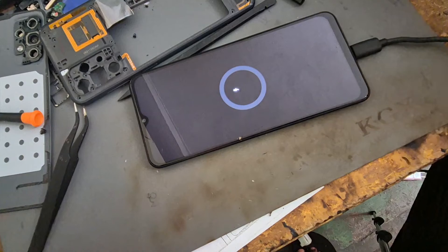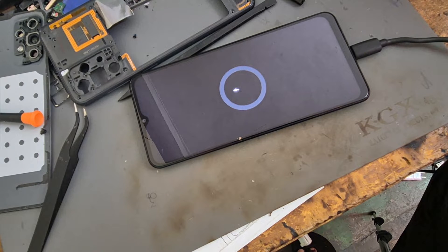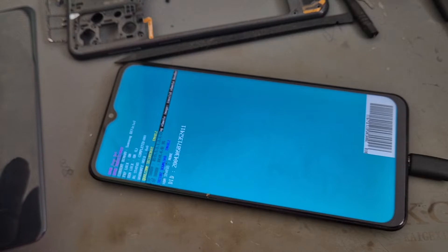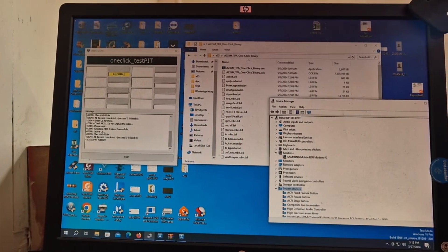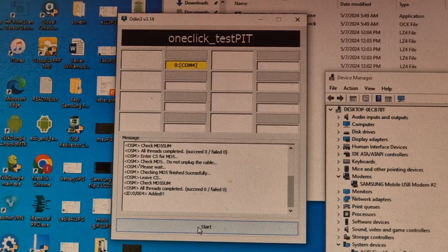Guys, you can see that the phone lights up. I'm just about to flash the device, but we need to get some charge into the phone first. I actually gave it a few minutes to charge — it's very good to do this with the battery charged up so that we don't get any problem when we flash it, or it doesn't run out of power, which can create more damage. We are actually in Odin mode now. I want to show you on my computer — this is detected, you see this yellow icon here. It's actually ready for us to flash. Let's go.